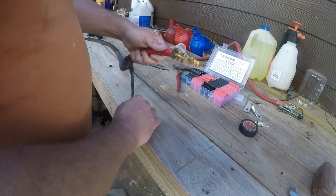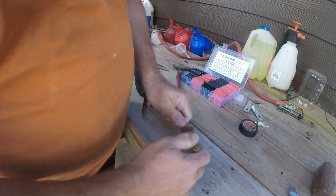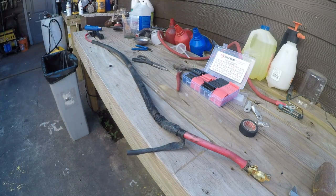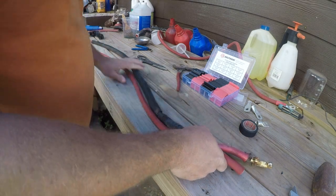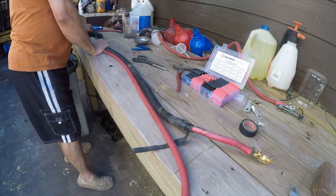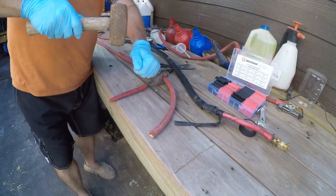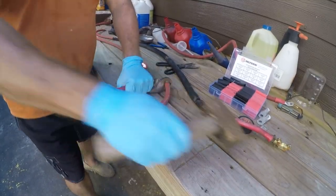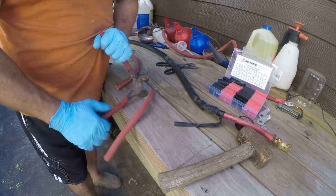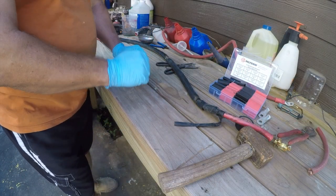So this is what's wrong with what they had done. I mean, how are you going to get 300 amps through that? You're not. So we have more than enough here. So let me go check this on the truck. I'll be right back. All right, I'm going to do bad things and see if I can. There we go. Hey, that worked. That's a halfway decent cut.